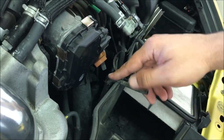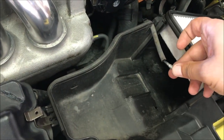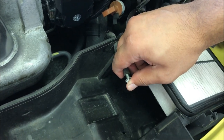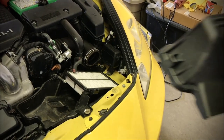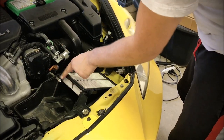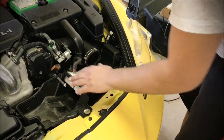Now this vacuum line — you might ask what we're going to do with it. You could plug it back over here using a used lift bolt, which works quite well. You want to plug it up with a bolt right here and press it in as much as you can. Installation is the same as removal. You can put a zip tie around this to prevent it from coming out, but if you use the lift bolt it's just not going to come out at all — so you're perfectly fine and this is not going to get sucked into the engine.